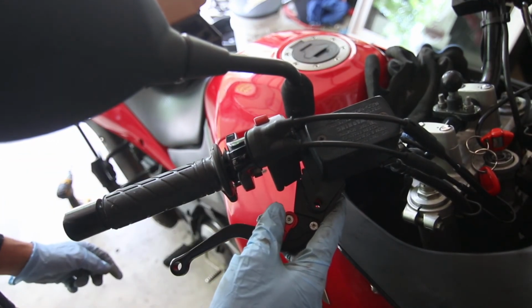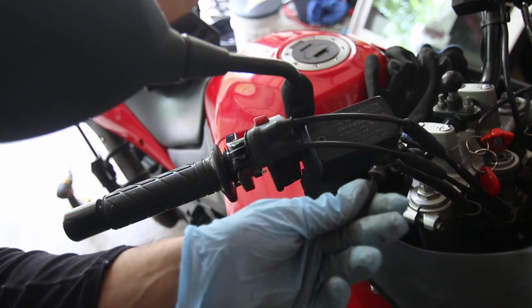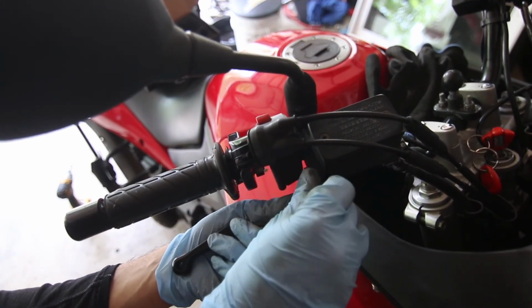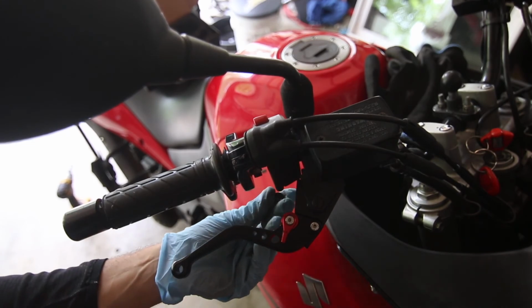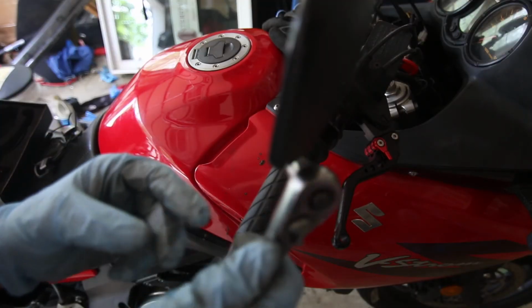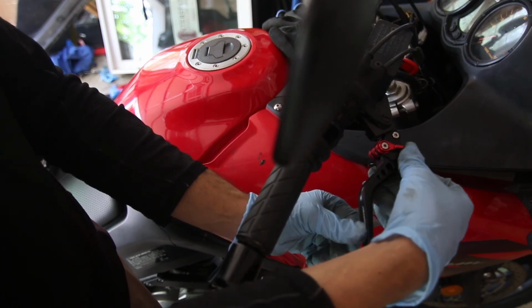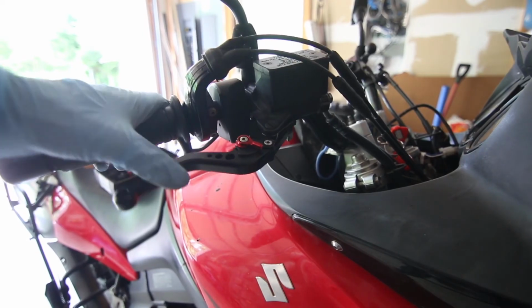And look at that, it looks better already. It is kind of short though. So you're going to have to take the existing rod that you took out, unbolt the nut, and just push it in. There we go, that's through there. So the bolt has gone through. Now I'm just threading it underneath. Now I'm going to take my 10mm wrench and tighten it. So there is some adjustability here, where six is further out and 1 goes in. Looks pretty good. I like it.